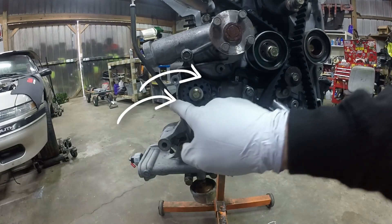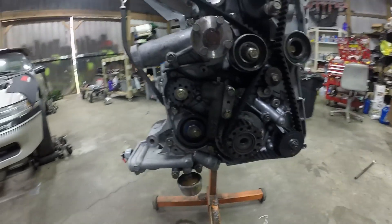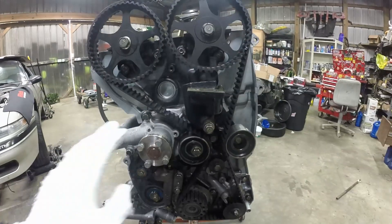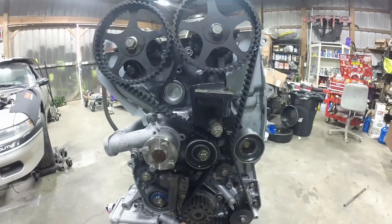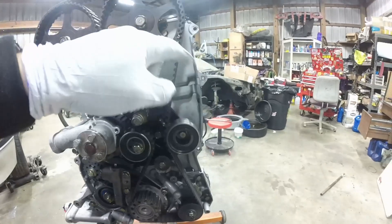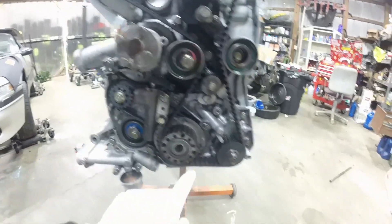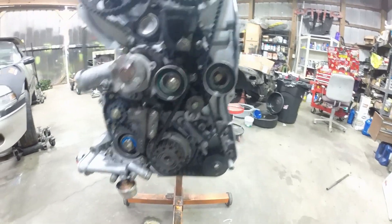From this timing spot right here to this on the oil pump — this little nick right there. Then moving up here, you have a spot right here and a spot right here, and they line up in the middle. I've rotated over a few times so it's not at top dead center, but it is where it needs to be. Make sure you have nicks on each side. Mine have paint on each sprocket and each place where it should be lining up. Hopefully that helps some of y'all.